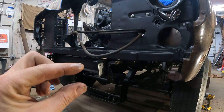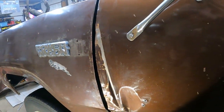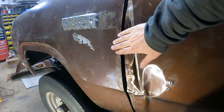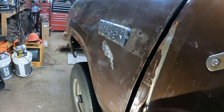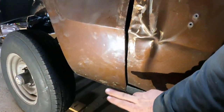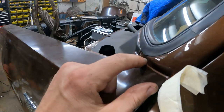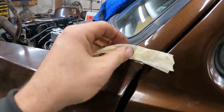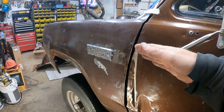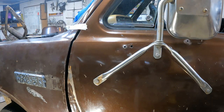It probably needs to come up maybe a quarter inch out here, which should straighten that gap out on the door. The door does open and close fine and doesn't bind on the fender, but the gap is very large. This fender is bent — flared out a little where it creased. This lower gap and upper gap are telling me something is off. The fender is quite a ways away from the cab, and the paint was thin there, so the original fender was up tight to that joint. Everything that attaches to the cab is loose right now. I've got the floor jack under the core support — let's see what happens.